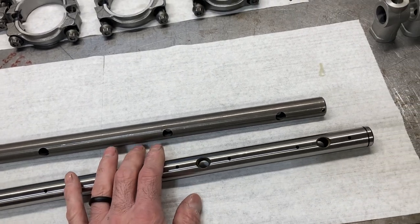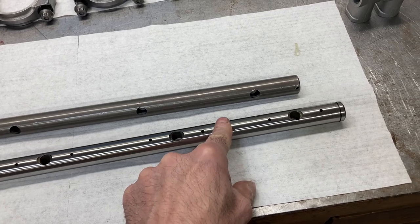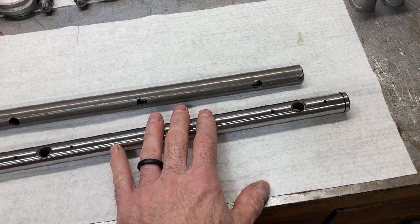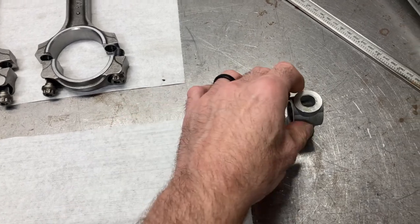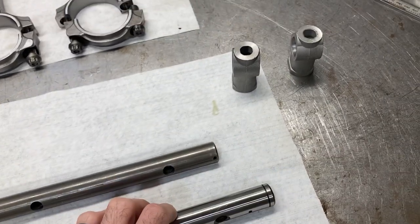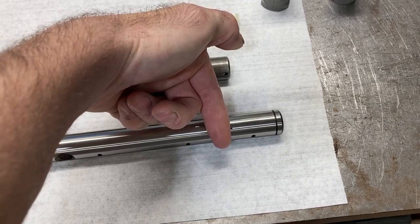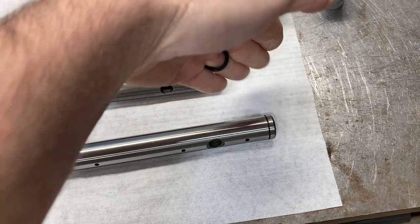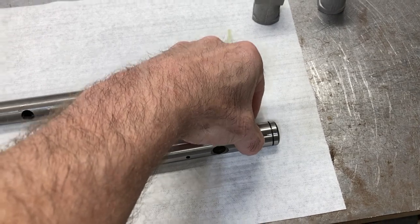The saving grace when you do something like that is to use the heavy duty shaft so you don't get any flexibility or deflection in the shaft. It's not so much important on the center stands to use a billet stand, but it's really important on the outside to use an end stand. If not, you have a rocker arm here, your stud or bolt, and then the rocker arm sitting out here with all your spring loads acting upon this end of the shaft which is unsupported.